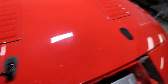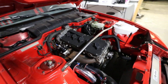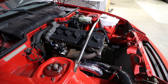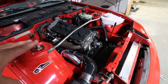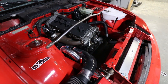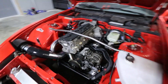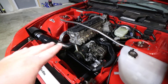Under the hood, we already have the 07k mocked up. This is the five-cylinder Volkswagen 2.5, aka the 07k. This particular engine came out of a 2008 Jetta. For those who are not familiar with the engine, it uses the same bore and stroke as the Lamborghini Gallardo 5-liter V10. It actually shares a lot of the same technology and basic design of the cylinder head, which is really cool. The Gallardo header actually pretty well just bolts right up. The engine is in and bolted in with all of our swap parts.